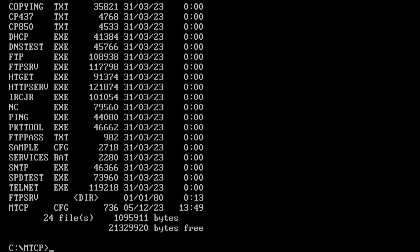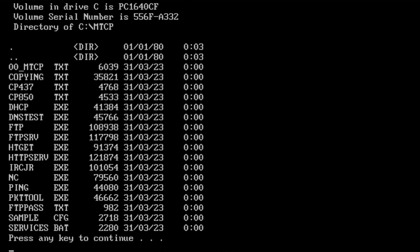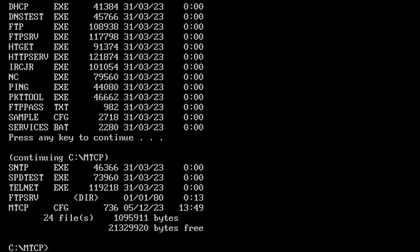And you download them on GitHub. They're very small, fit on one floppy drive. Again, you copy that all to your hard drive, and you need to make sure that there's a file in here called MTCP config. There's a sample config file that you can use as a starting point. And there it is, yeah, the bottom one, MTCP config.